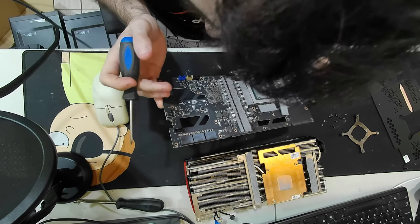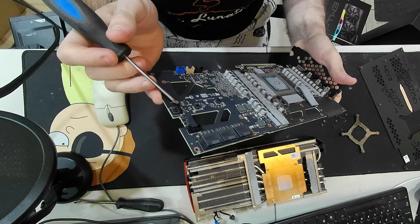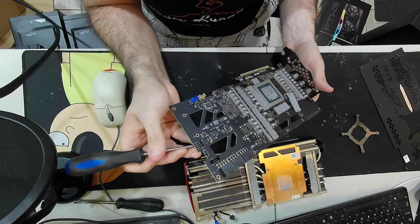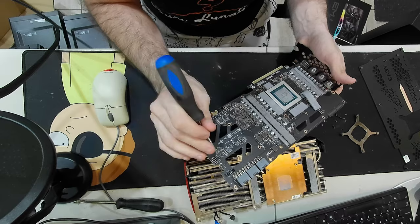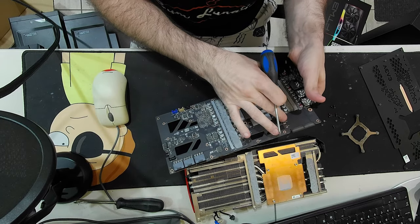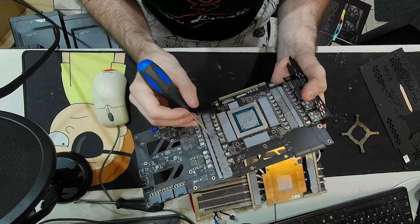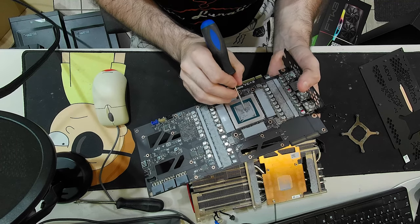This looks like a fan header over here - that's kind of nice. And an RGB header as well. Why would you want a fan header and an RGB header on a card? With the fan header you can control all your case fans with the PWM from the card. Then you could use Afterburner to control your fan curve - that'd be handy. Same thing on the chokes here - this is this thermal foam stuff. I don't like this; I'm gonna replace this with pads.